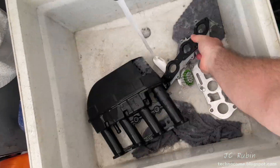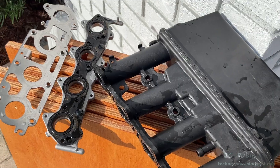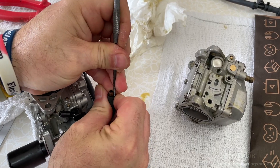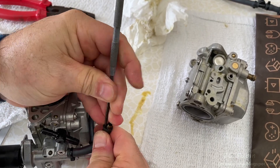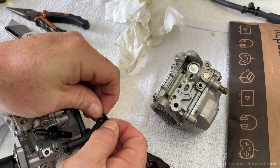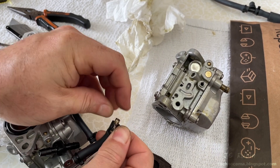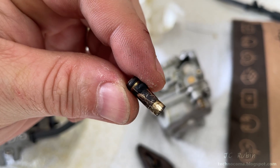The silencer and two brackets are brought to the sink where they're washed with soap and water — I want to put them off to the side and they're oily and greasy — then left out in the sun to dry. The piece we saw was broken: I want to remove that brass fitting from the hose. What I quickly realized is somebody had actually attempted to glue all of this together, and the more I tried to remove it the more I risked damaging that piece, which is not a replaceable item. So I ended up cutting it out of the hose, since I could replace the hose. Even with the hose cut, it was still stuck — that's how bad it was. Pretty shady repair, but this piece can now be repaired and we'll come back to it later.